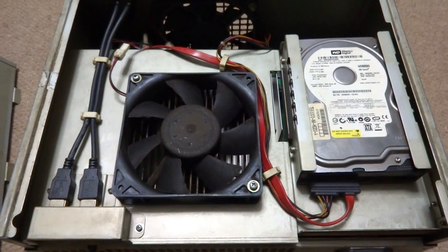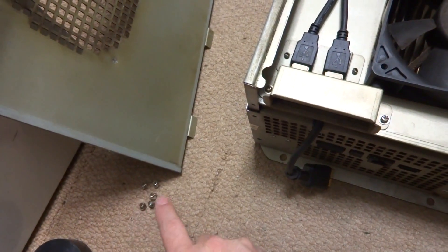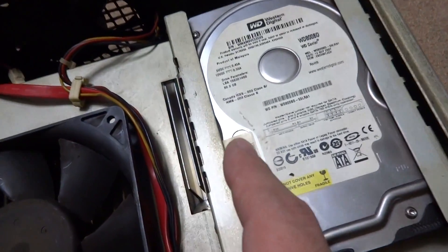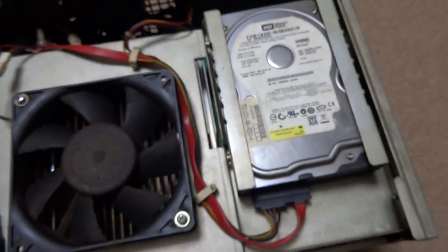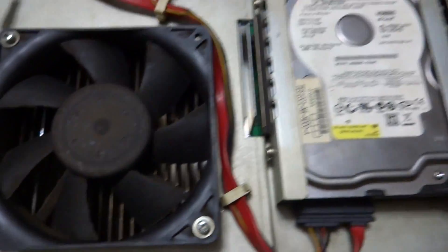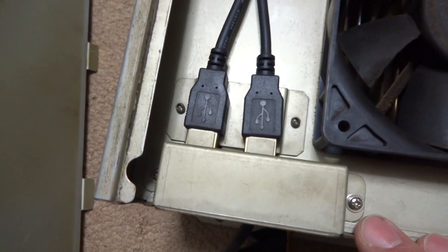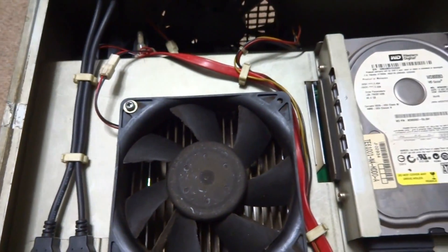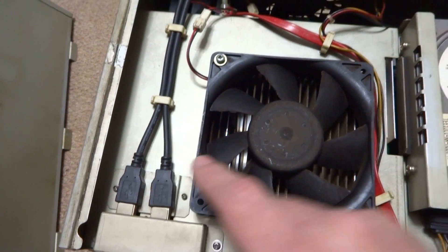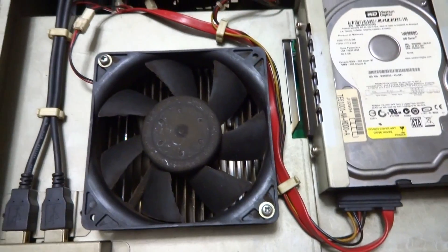As you can see, we've pulled off the top cover — it just pops right off. There were about five screws in there, one of them missing. Luckily the hard drive is still in there — you can see Tekken 6 on there, TE6. No telling if it still works. It's quite yellowed or brown due to the extreme heat and temperature. The next thing we're going to do is disconnect the front USB cables, disconnect the fan, remove the hard drive, and then try and remove the bottom tray.